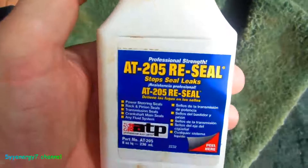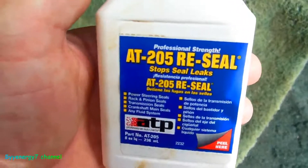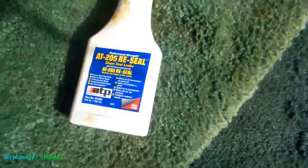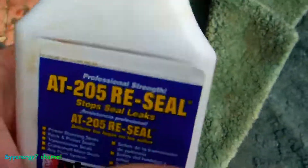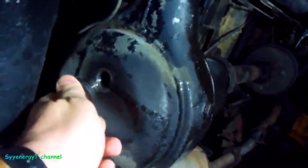This will also work on hydraulic jacks if you've got a leak and you're trying to find parts that are as rare as a dodo egg - just change the fluid and put this in there, most of the time it works. So if you've got a Jeep with this problem, try this stuff. I just checked the rear - it's still full, just a slight dribble coming out. So there's a leak but it's not that bad. If I was lazy I could just put the AT-205 in there and it'd be good.